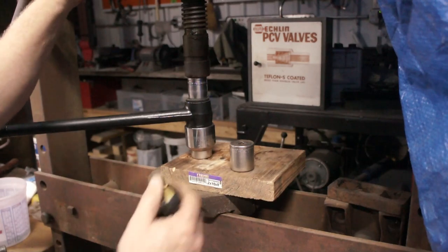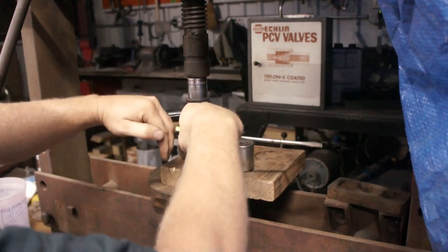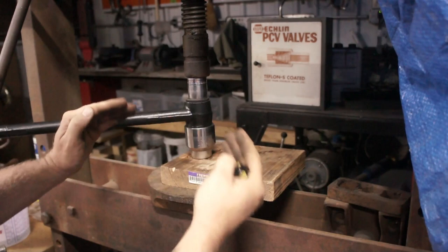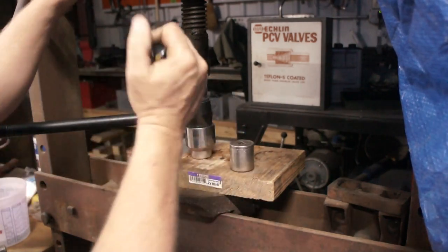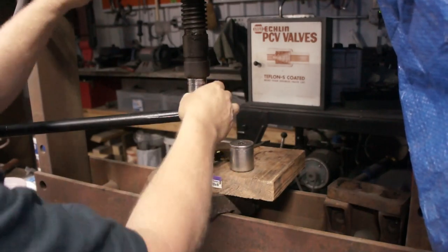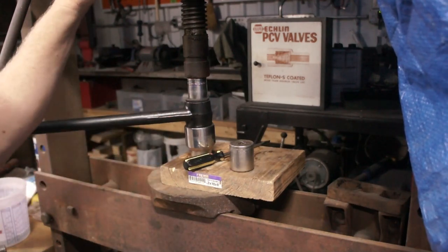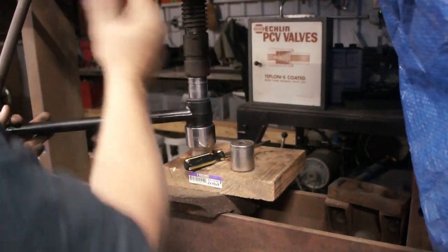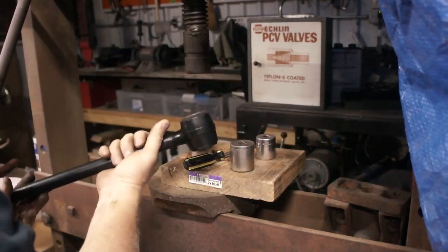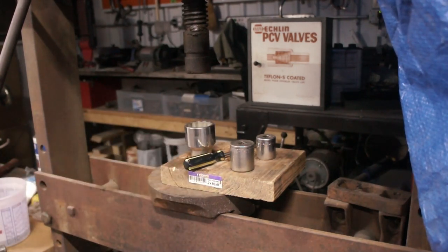Upside down socket on here, and that tends to push obviously the center of the bushing down first, and then the outsides tend to curve over, and you just do it, you know, don't expect to do one push and you get it down. I pushed, I released it, I pushed, I released it, keep dipping it in soap water, and we eventually got it. So it's more tedious than it is difficult, but it's doable. So good news there, ready to go back on.